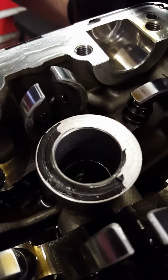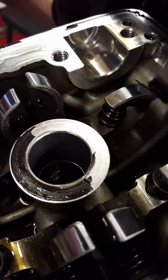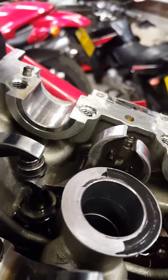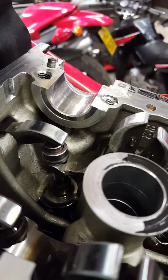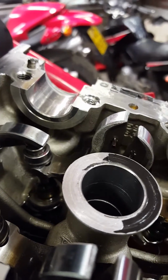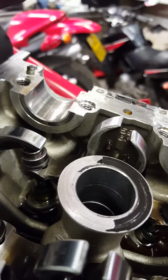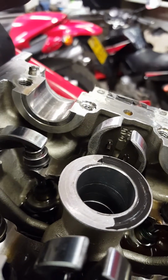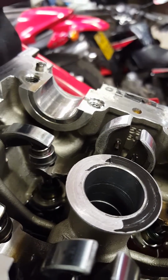The spring on the valve itself, as you can see here, I've put on purely to keep the rocker creating some force on the shim, so the collets will not fall out and everything is in one place. I strongly suggest always checking whichever cylinder you're working on and putting the engine on TDC. If the piston is at the highest point, then even if by mistake the valve drops slightly, it's not going to go all the way down. It will only drop about 10-15 millimeters max, so you always have enough valve sticking out to use pliers or a magnet to lift the valve and put everything together.